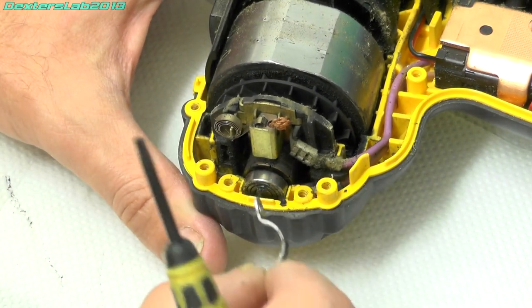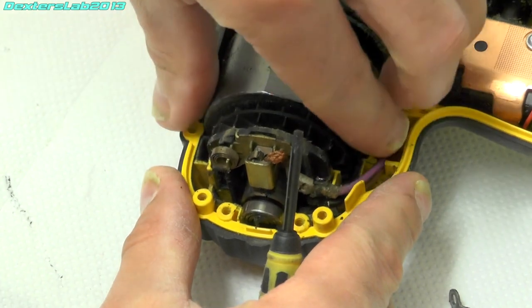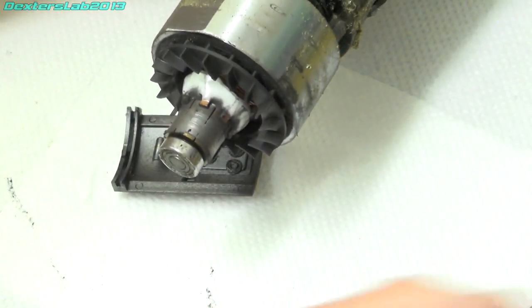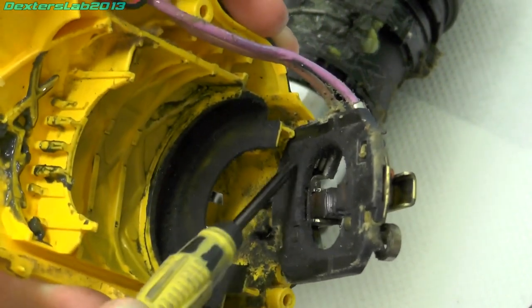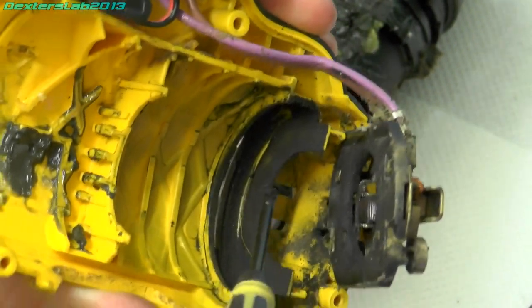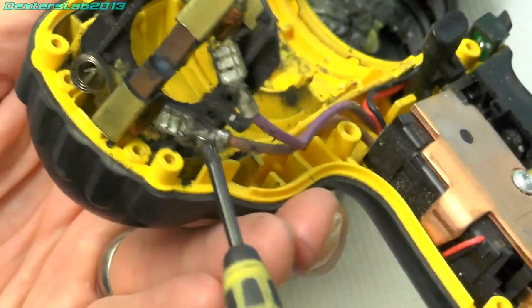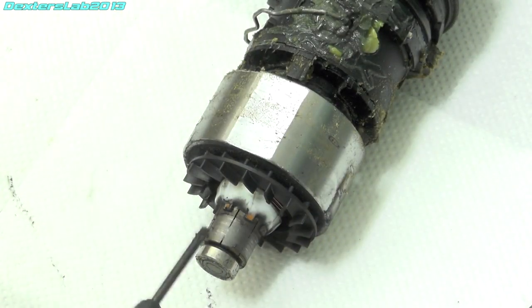This small clip here was just holding in the bearing on the end of the motor, so hopefully we can lift all this out. You can see in here there's a massive build up of grime everywhere — all this blackness in here is all off the brushes. I'm not surprised this is not happy at all. So I'll remove this from the spade connector and take it out to give it a good clean up, and then we'll look at cleaning up the armature as well.